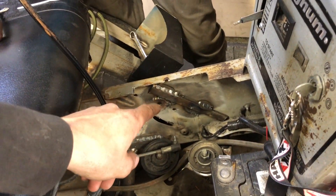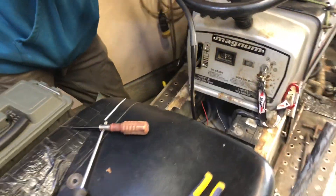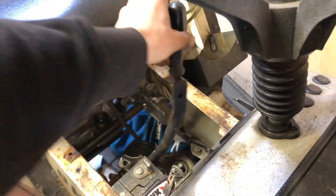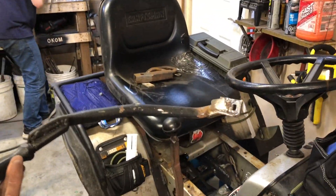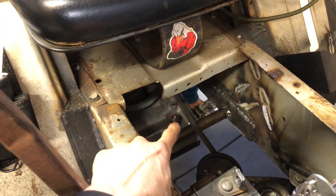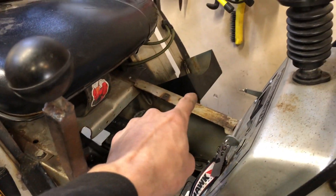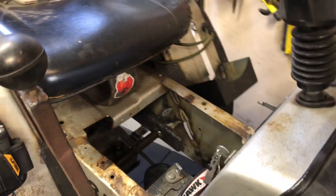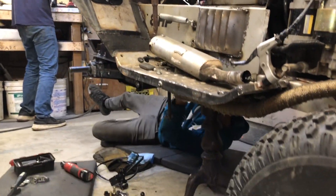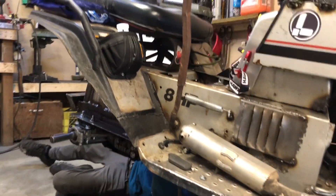We're just doing some welding and reinforcement on the inside, but the shifter linkage absolutely fell into place. Before, Tony's system of shifting was just a sweep rod — you grabbed it and swept it. That is not a good system — we'll use it on the three-quarter inch axle shaft diffs, not good. Nick's little bracket is going to go off that guy over to the side and then we'll have a linkage bar up here that operates on a straight pivot front and back — five speeds forward and one speed reverse.